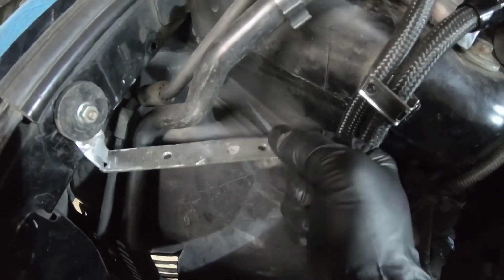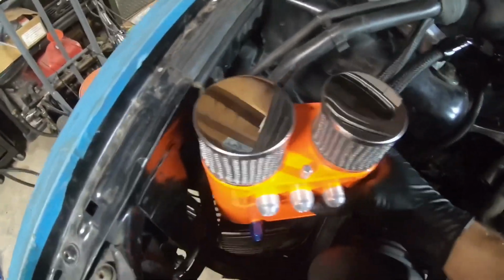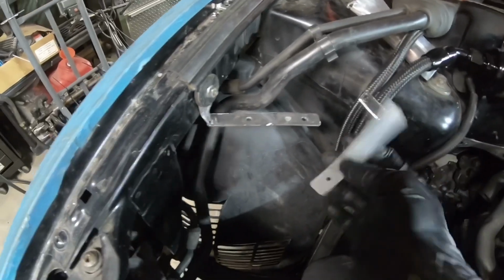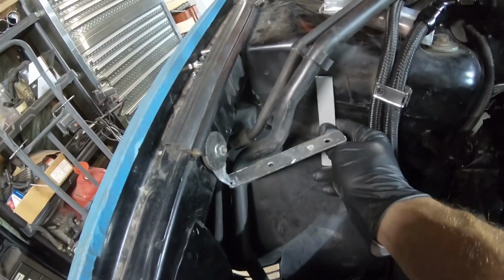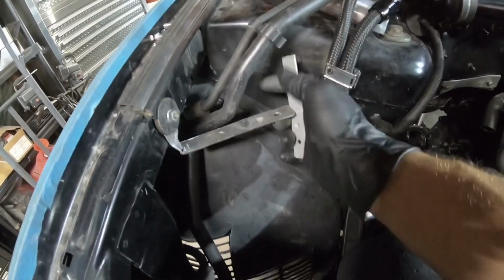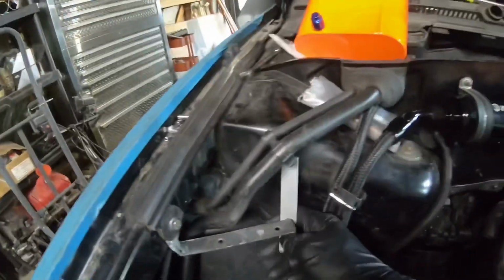I'm gonna try to make this bracket a little more stable, because see, it's not screwed in all the way. You guys know what I mean. See, it wobbles a little bit. So when I put this oil catch can on here, it wobbles, and I don't like that. So what I think I'm gonna do is take this straight steel plate. That's the same one as this one, but this one is already polished, I guess you could say. We're gonna take this and basically bend it in the L shape. And I'm probably just gonna weld it to this shock tower right here with this welder that I have right there. So yeah, that should be good. And then I'm basically gonna make a hole here, and then we're just gonna grind it. Or maybe I could just weld it to this and call it a day. Yeah, we should probably do that, right? Yeah, sounds like a good idea. All right, let's get to it.